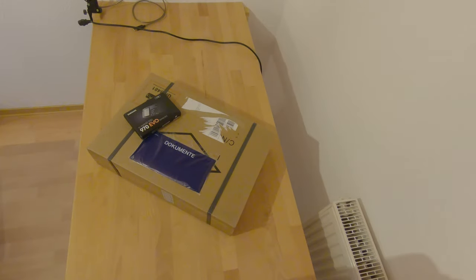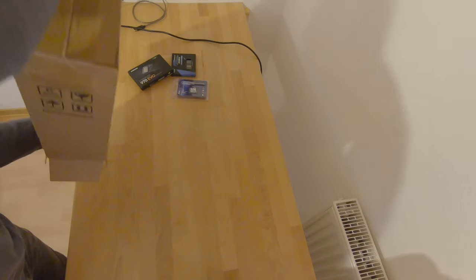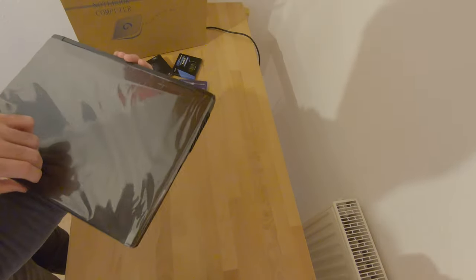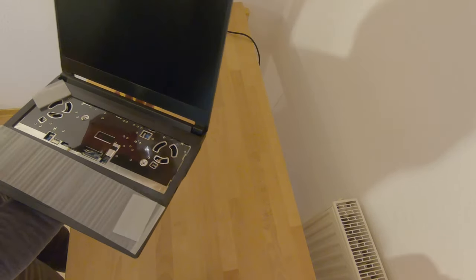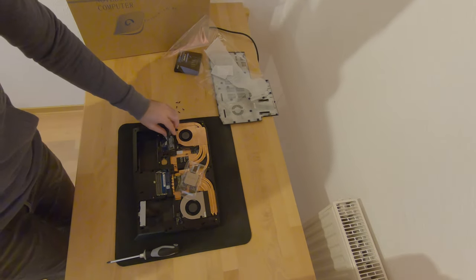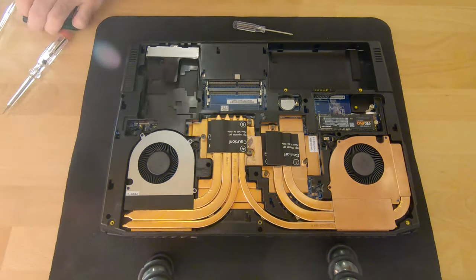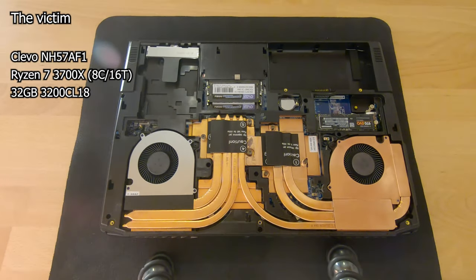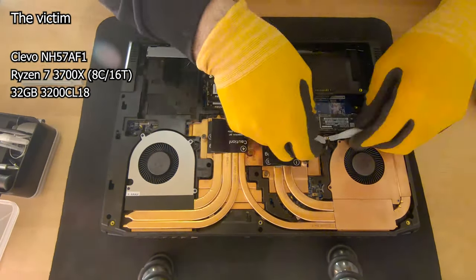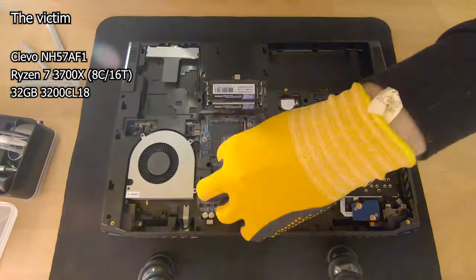This video is all about the introduction of the journey. But before I can start, we need a victim — and I surely don't want to risk my daily-used laptop. So I made some unreasonable purchases and finally got the very same laptop again. It's a 2020 XMG Apex 15, better known as the Clevo NH57AF1, with an RTX 2070 in the 115W Max-P configuration. I saved some money by going with the barebone version without a CPU, memory, and storage, because I got some hardware lying around. In its current state, it's equipped with my old Ryzen 3700X pushing 4.2GHz at 1.225V.